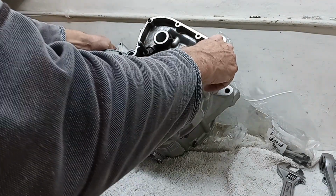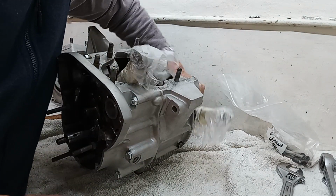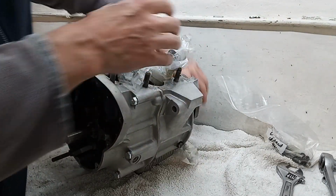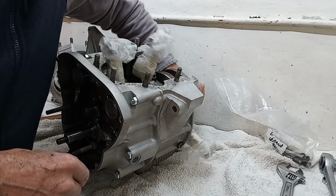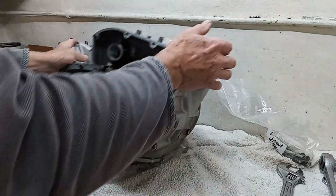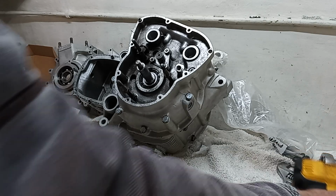Anyway, so now we've done that, I think we have a nicely turning crankshaft in. It was just fractionally out of line because it wasn't bolted up, and that's why that bearing wasn't happy. And now we're all hunky-dory. So good. So timing side on, and what we're going to do now is turn the engine round, and we'll put the drive side casing on.